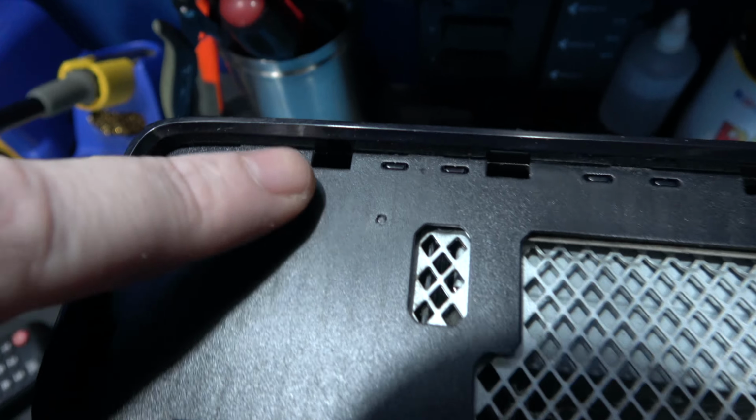See if we get the CPU key. We should get the CPU key now. Major parts done now, guys. Pretty much all I have to do now is make a glitch image using JRunner, reprogram over that glitched image to the NAND, and that's it. We got a